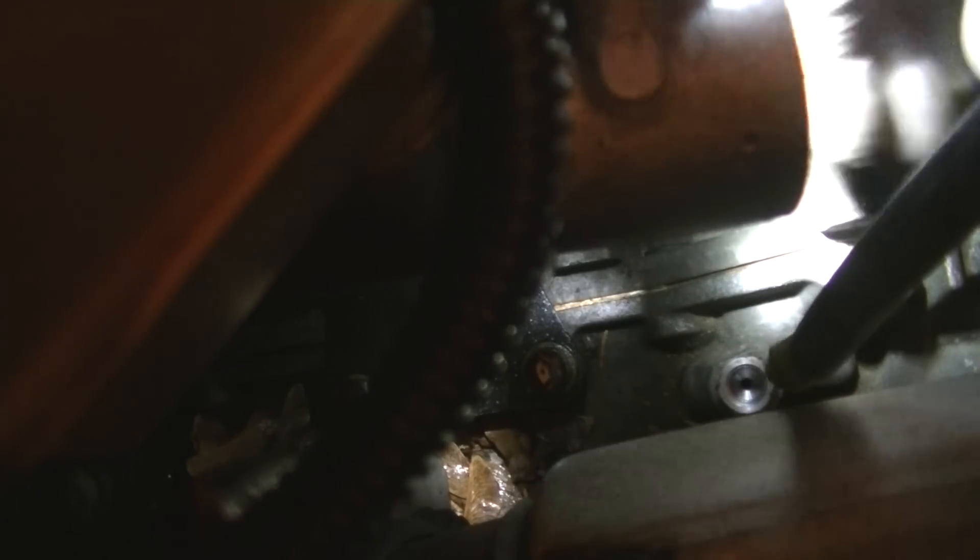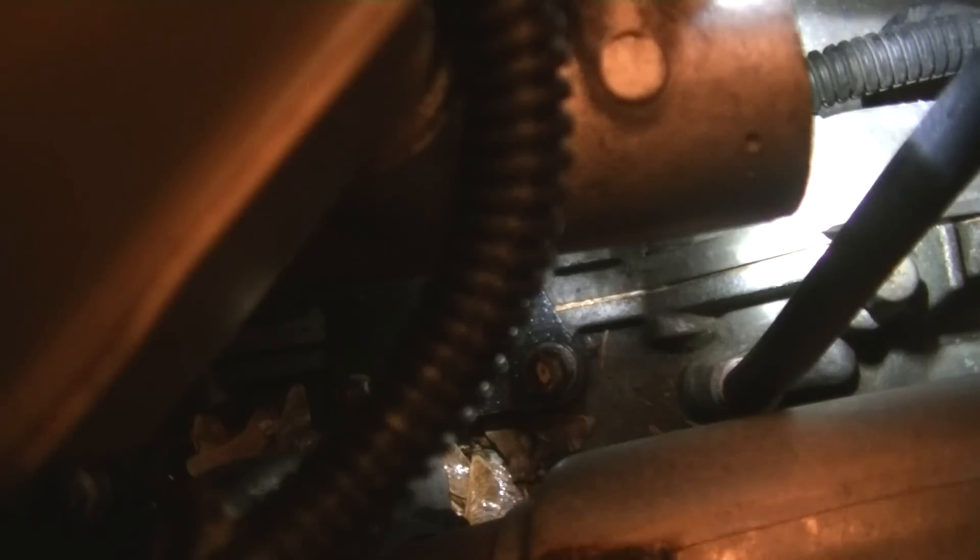The test port fitting is in there. Now we're going to thread our hose down into the fitting. If you do it this way you don't have a chance of messing up the threads on the transmission case. Now that it's in, I can just spin the gauge from way back here and tighten it up a little bit.